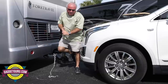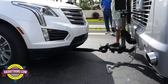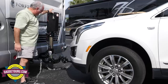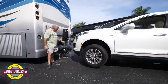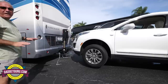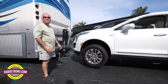We're hooked up. Now the key's down and we're going to lift the car up. The car may be two feet. There it is — the car's up. It looks a little low but the bus is not in driving position. Once the bus is put in driving position, it'll air up and the car will be about maybe 12 inches off the ground.